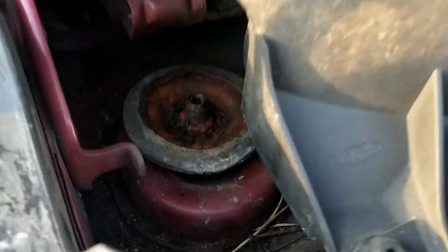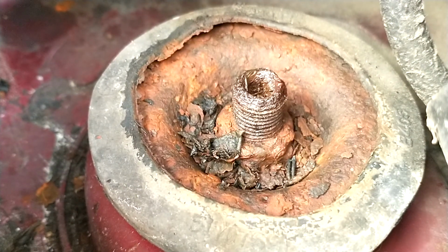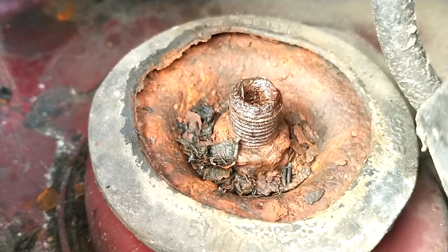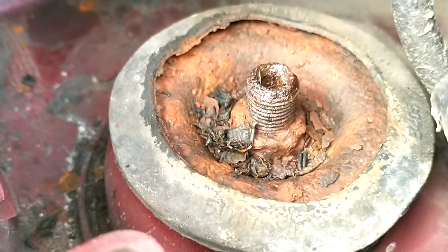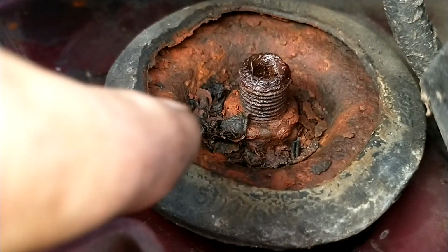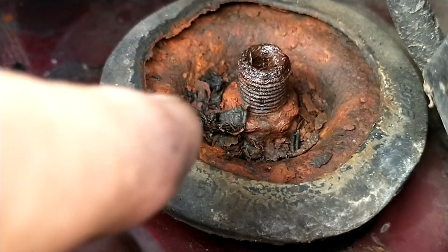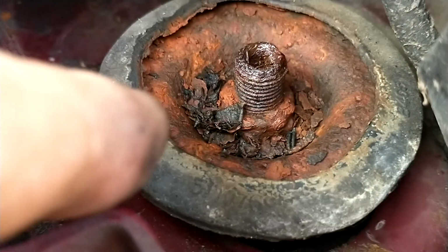What I have noticed on this is the top suspension mounts are in quite bad condition. So if any work is needed on the suspension, this bolt would need to be opened. It may not open because of the state it's in, so you'd need a replacement of this and the whole shock absorber strut.